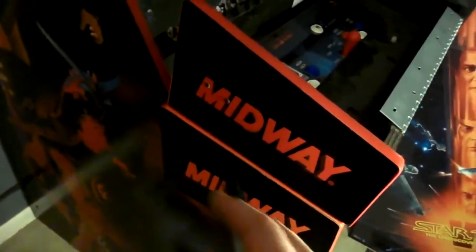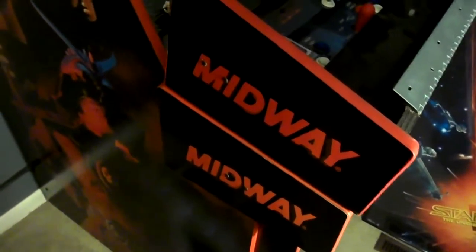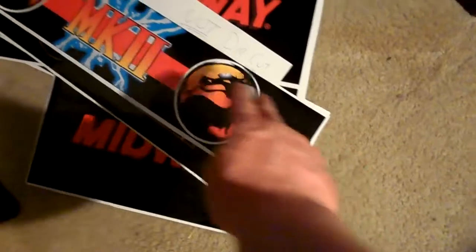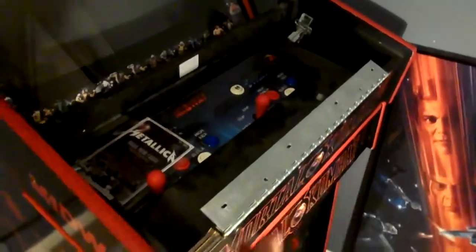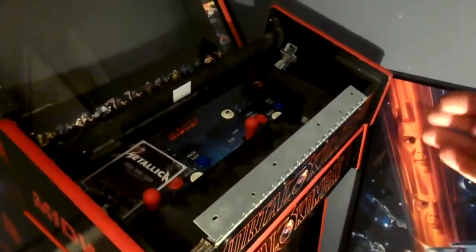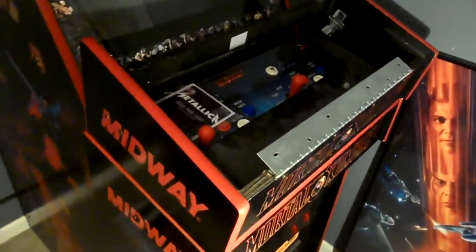I was fortunate enough to line them up perfect the first try. The best way to do it — I didn't really want to go into it in this video, but: get a pair of scissors and cut the decal out exactly on the edge of the lines. Then peel back about half an inch or so of the backing material, place it where you want it to go, tape it in place, and stick that half inch down. Then remove your tape, pull your backing off a little bit at a time, and squeegee out as you go. As you squeegee, pull the backing material off — squeegee and pull, and that's the way I do it. I would recommend doing it that way.